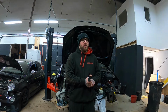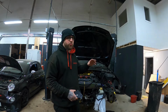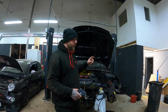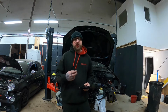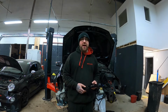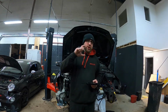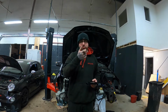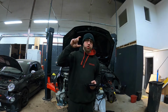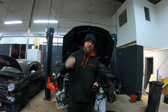So when I've been doing everything else that I'm doing at the minute with the other intercooler setup, that's an ongoing video. I don't know which one's going to come out first, but when I've been doing that, I decided I was just going to do a gearbox oil change, and I was going to buy the K1 and K2 clutch solenoids just to change them, just for the sake of while I'm in there. So I took my drain. If you've ever done a DQ250 before, you take your main drain plug out, and then some oil will start coming out, and then you have a level tube in there that's plastic with an Allen key in the center. So you take that out, that's the level, and it drains all the oil out.